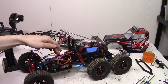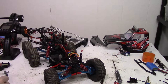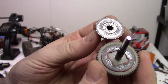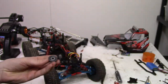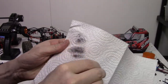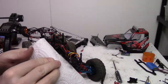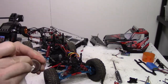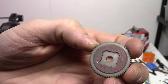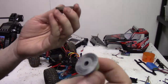Now it's time to have a look at the slipper clutch and see if that needs some work. I just got the slipper clutch out and you can see how greased up they were — it's no wonder I was having some pretty serious slip. Let's get these cleaned up with some paper towel. I've got most of the oil and grease wiped up. You can see there's a good amount of wear on here though, so what I'm going to do is sand this down — sand down the plate a bit — and hopefully that will give me enough traction.